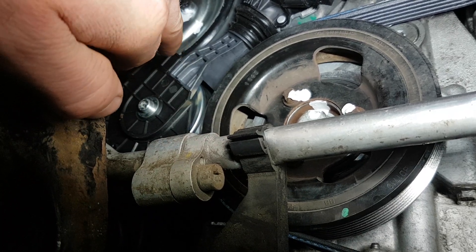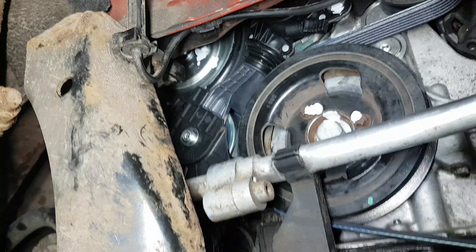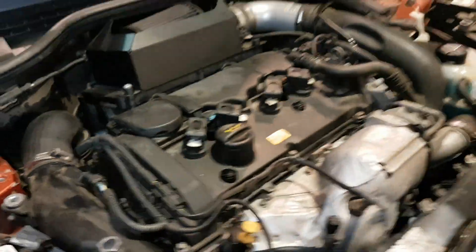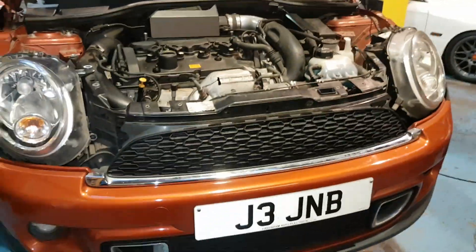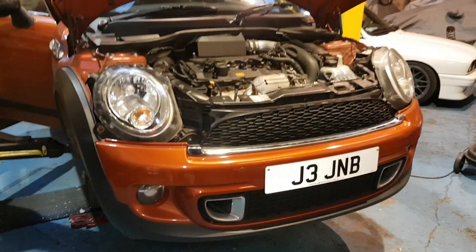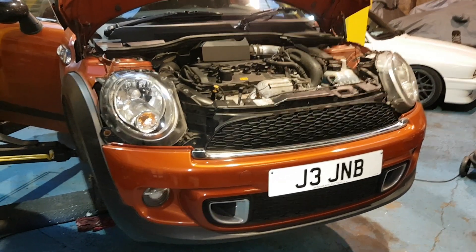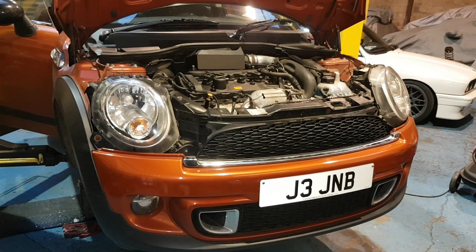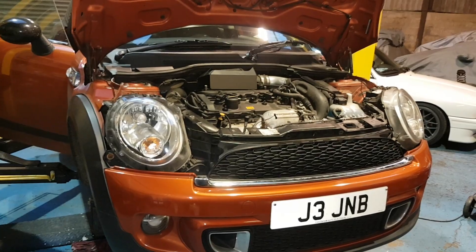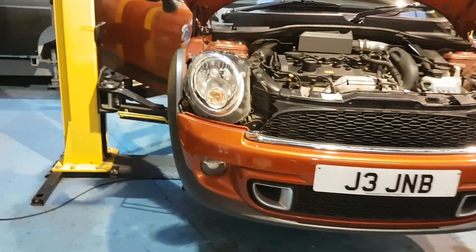That wheel is connected at the minute, and once I start the engine it would go outwards and wouldn't be in contact with these two pulleys anymore. Once it reaches temperature again it will retract back in and the crankshaft will start turning the water pump via this connection. So if you've done a brand new tensioner, they do make a death rattle noise, and it was a very pronounced noise — it sounded like a little end bearing to me.